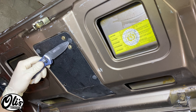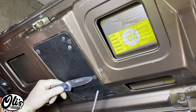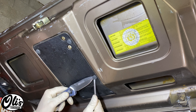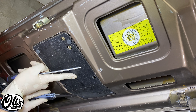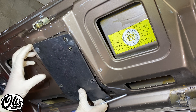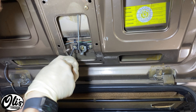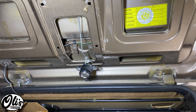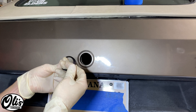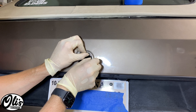Do the same on all of them. You will most likely end up breaking one in the process — that's just kind of the unfortunate truth of 30-year-old plastic at this point. With this removed, you can now see these two screws right here. Just take a Phillips and undo those. And now my lock is out. Lubricate your gasket with some dielectric grease, and then slide this groove of the gasket around this metal right here, just like this.